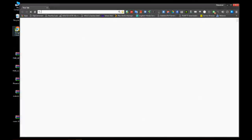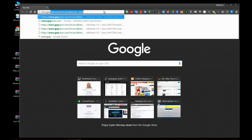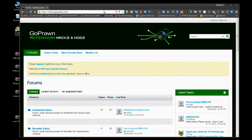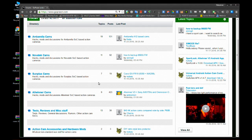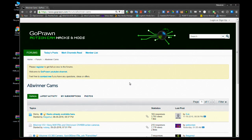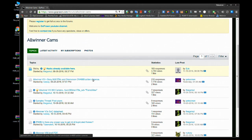So on a Windows computer, we need to download some files. Go to www.goprawn.com, Goprawn.com. Go to the Allwinner Cams forum or topic. In the Allwinner Cams forum, go down and we see the Allwinner V3 Plus Sony IMX179 topic. Click on this.